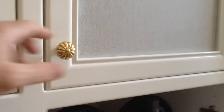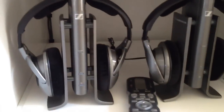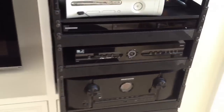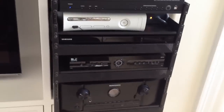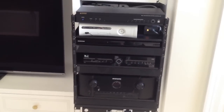As far as the sub, we couldn't wire the sub to the location we wanted, so we had to tuck the speaker into the same cabinet, and considering the application it really sounds good. This rack actually slides out and allows us to swivel it if we need to — comes all the way out, swivels — so we can maintain the rack, dust it once a year, and if something were to fail, such as the DirecTV box, or if DirecTV service improved and they wanted a new box, the HR 26 comes out and they're able to replace it without too much difficulty. You're not dealing with wires that are entangled and filled with dust — this is very modular, very simple, very clean, and it makes everything streamlined in the installation.